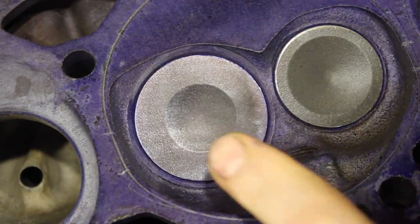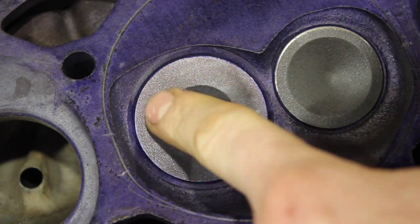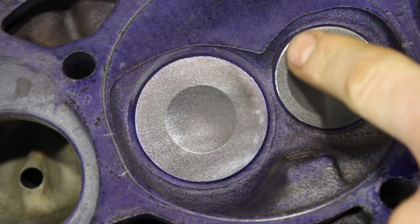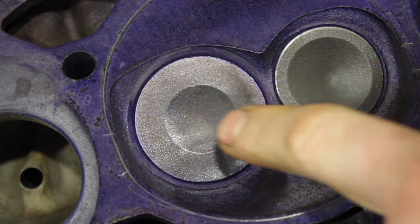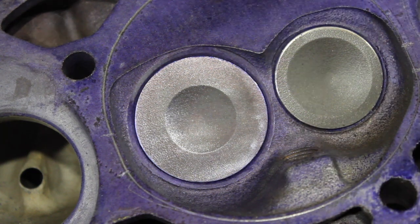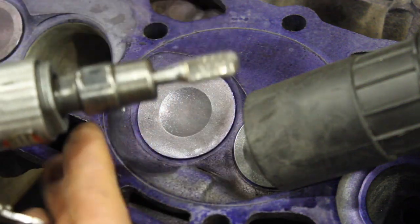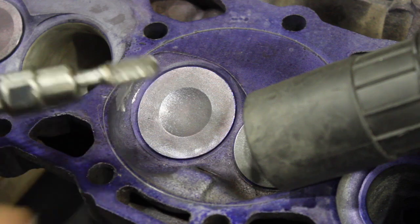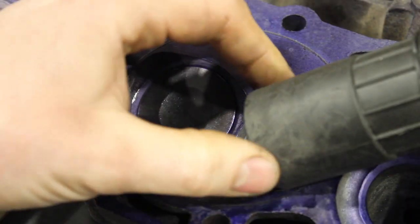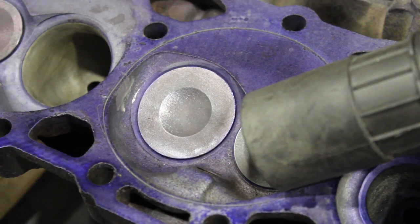One more thing: you're going to want to get yourself two extra valves as grinder valves. You're not going to want to use your good valves, because as you're cleaning up the seat or the combustion chamber, even if you're really careful, you don't want to slip and nick one of your seats. So you kind of sacrifice the edge of the valve a little bit as you're getting in there to clean this up. Get yourself two extra valves — one intake, one exhaust — and use them to protect the seats as you're doing the combustion chambers. All I'm going to use for this chamber is just a round-nosed carbide. This is a quarter-inch grinder, MacTools carbide — a higher-end carbide that works quite well, lifetime warranty if the teeth chip. It's always good to have a good set of carbides in your toolbox. I also have a shop vac — it just helps with some of the debris. And always wear safety glasses; sometimes a respirator is not a bad idea either.